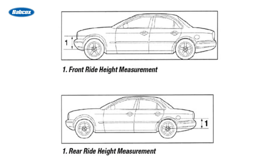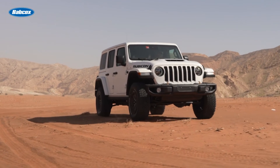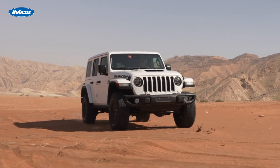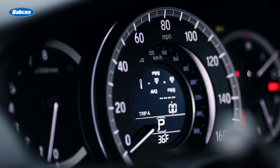The data from the sensor is used to measure the movement of the suspension. By knowing how far and fast the suspension is moving, the module can use the information to determine the size of the orifice in the dampener to control compression and rebound. The module uses and shares information with the anti-lock braking system, engine control module, and instrument cluster.